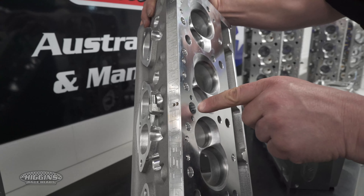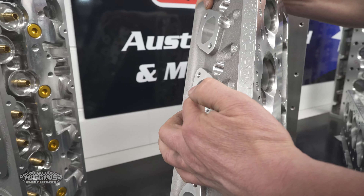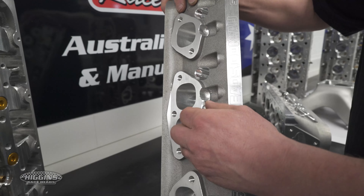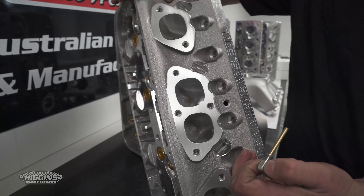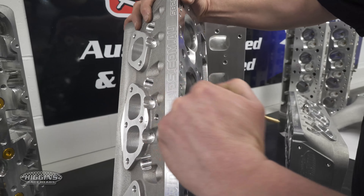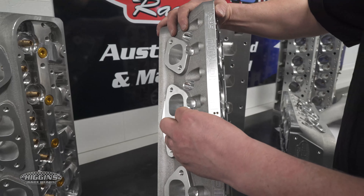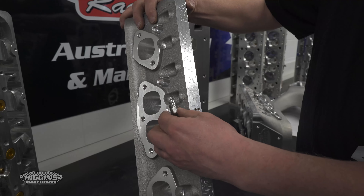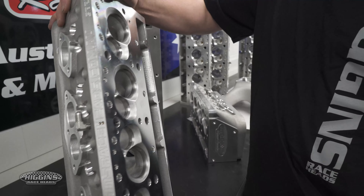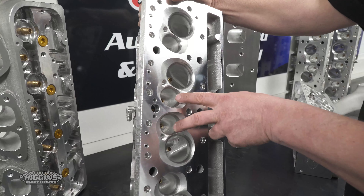Over this side we've got water going into the center of the cylinder, which sometimes on Chevys becomes a soft spot. We've got two holes that come in through here — we bring the water in from the water pump. There's a tube that goes in, drilled up on an angle, coming up into here. The two holes drilled through here meet it, so the line from your water pump pumps through and out through the two holes to keep this section cool.